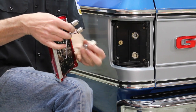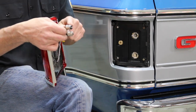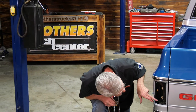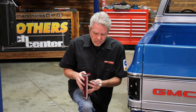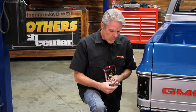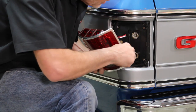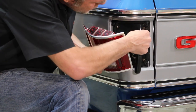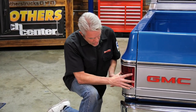The ends of these LED connectors look exactly like your light bulb, because they're going to go in exactly like your light bulb did. Notice there are two prongs on one and only one prong on the other, so you have to make sure they go into the right sockets. If you're not sure, just look in there — you'll see either one or two contact points. That small side connector you won't be using anymore; it was your running light and it's already built into the lighting system. Just get the right plug into the right hole, put it in with a quarter turn. If it doesn't go in, pull the socket back out, turn it 180 degrees, and install it.